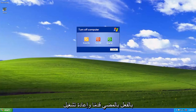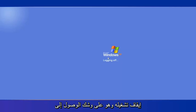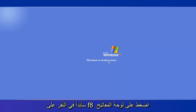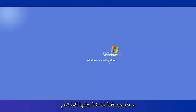So I'm going to actually just go ahead and restart my computer here. And as the computer is shutting off and it's right about to hit the boot or UEFI screen, I'm going to start tapping the F8 key on my keyboard repeatedly. You don't have to hit your keyboard too hard, just very softly. Just tap it every fraction of a second, just start tapping it repeatedly on your keyboard.